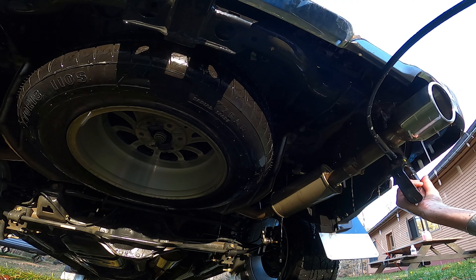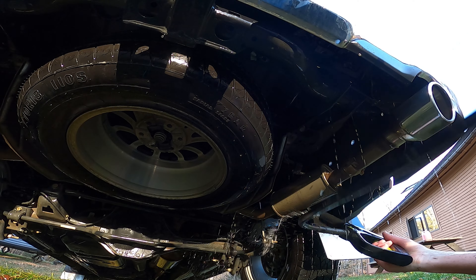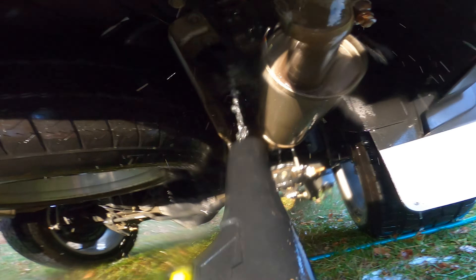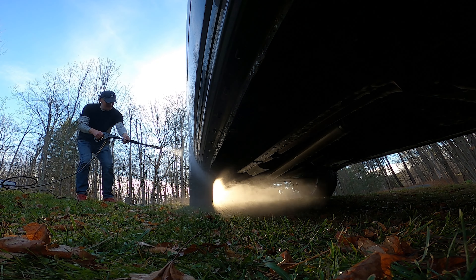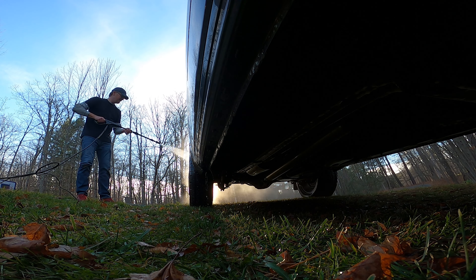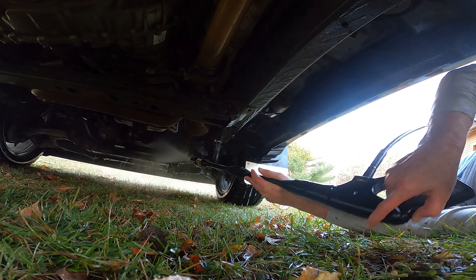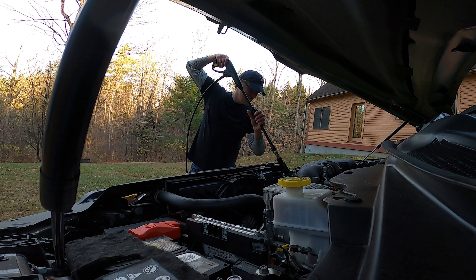You ultimately need to make sure you fully remove the cleaner so it doesn't affect the fluid film. It is a messy job, but so worth it. I also spray off the truck just in case the cleaner got on the body panels — this stuff can remove wax. I can see the dirt falling away, but I can also see that the previous year's fluid film is still there. This stuff sticks so well, and the pressure washer does a great job removing the dirt that the cleaner loosened up.